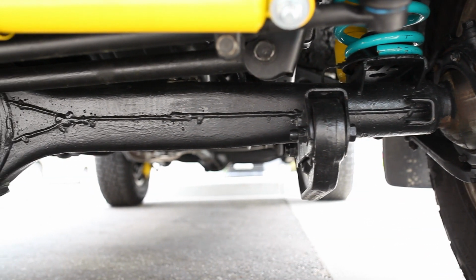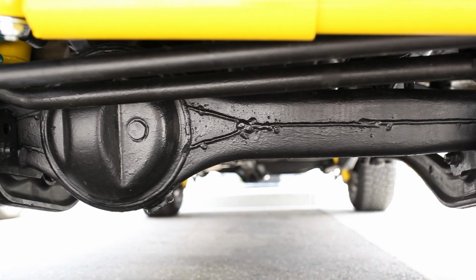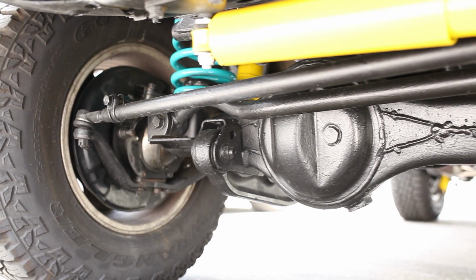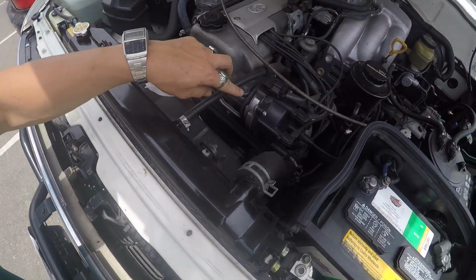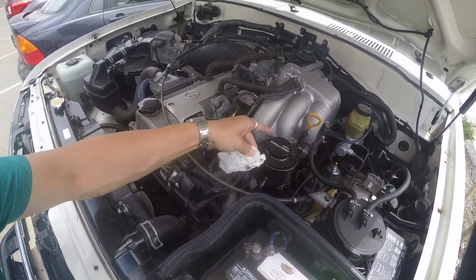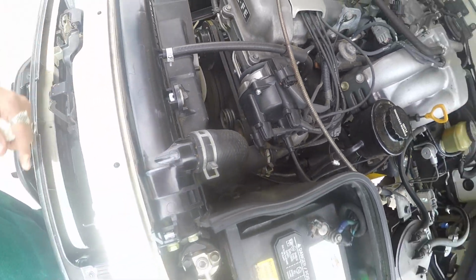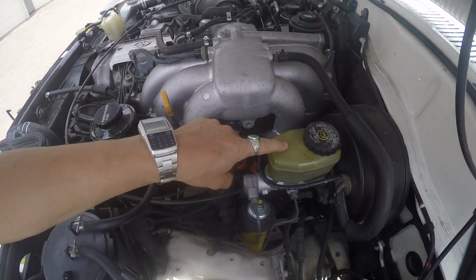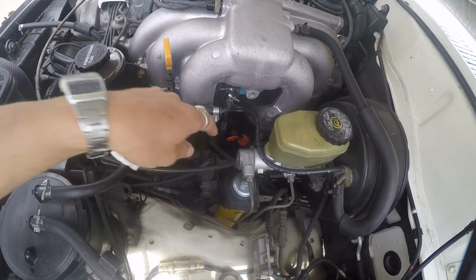But anyway, I started out with doing all the fluids. So I started doing the axle fluid, or axle gear oil, and then first of all the motor oil. Then I did a full tune-up with spark plugs and wires and distributor cap, and all the hoses that started to go, whether it be heater hoses, vacuum hoses, radiator hoses. Did all my radiator hoses actually, and then probably a couple months later my radiator went out. Did the belts, and this is all before I did any of the suspension or any of the cosmetic situational things that have come up.